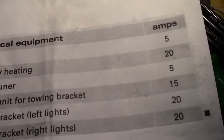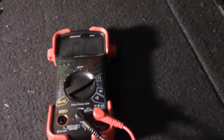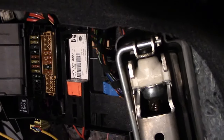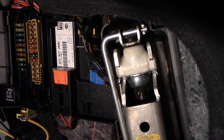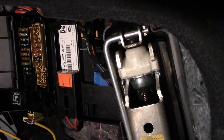On the brown box, number seven is the MMI. I decided to take out all the fuses one by one and test with a multimeter — just put it in ohm position and test each fuse. I double-checked all the fuses and they are all good. If you found a burned fuse you just replace it — easy fix. But in our case, the fuses are good, so we need to troubleshoot further.